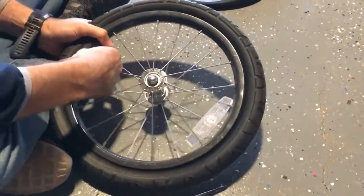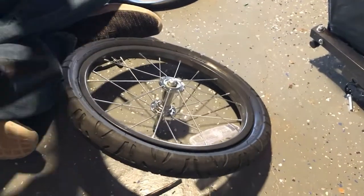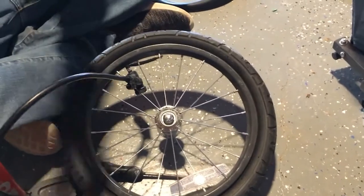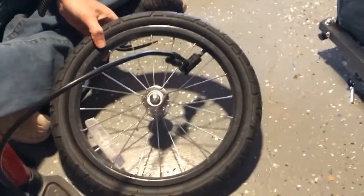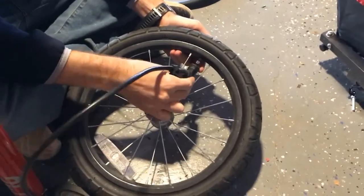And now we're all done seating the tire. Let's go ahead and fill this up. If you haven't filled a tire before, it's pretty straightforward. Unscrew the cap, put the pump head on, pull it like this, flip the lever — that locks it in position and allows air in. Go ahead and pump it. You can hear it; it starts to move itself around. Kind of help it situate itself. It feels pretty tight — that's good. Remember, these small tires, these 16-inch ones, they'll take a bit of air since they're so small. So we'll put the cap back on.